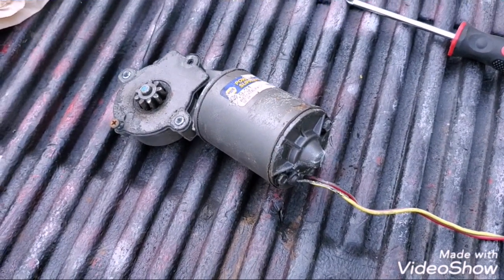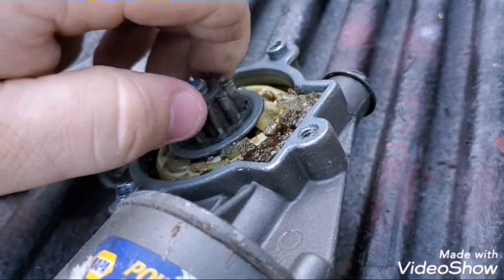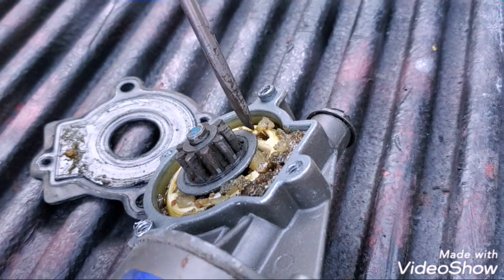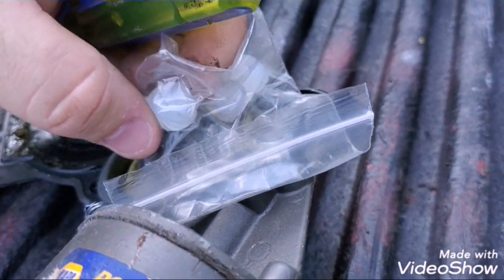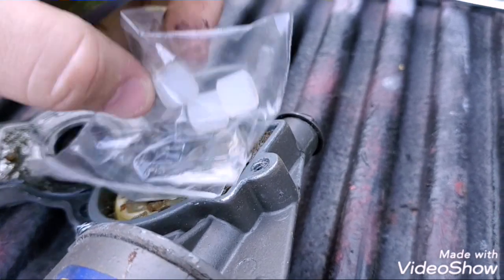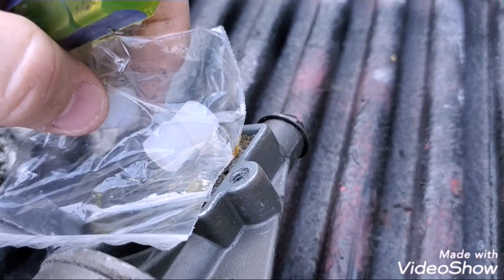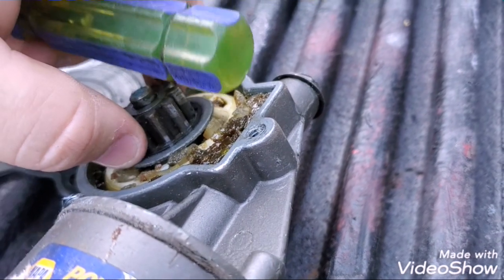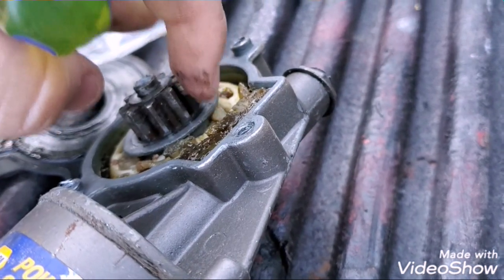At this point it should be catching, and you can actually see the bits right there — these little plastic nylon pieces are just chewed up. What replaces them is these. You could replace them with metal washers of the same size, but the problem is these are a safety feature — breakaways. If you or your child hits the button while their hand is in the track, these will grind up rather than break your kid's hand or shatter the window. So we need to lift this straight out to replace those pieces after we clean the gear out.